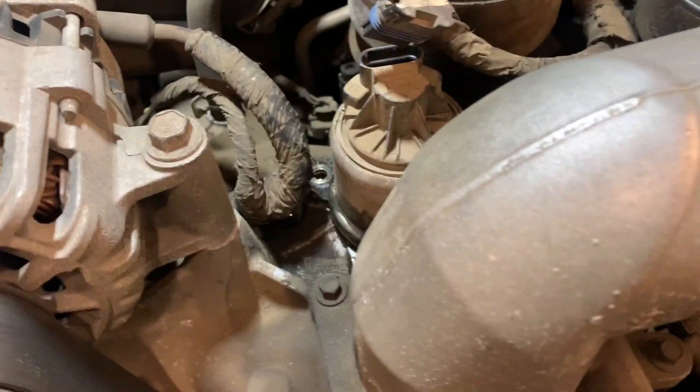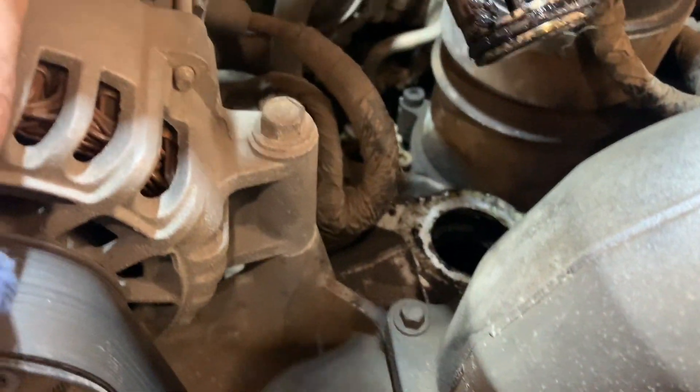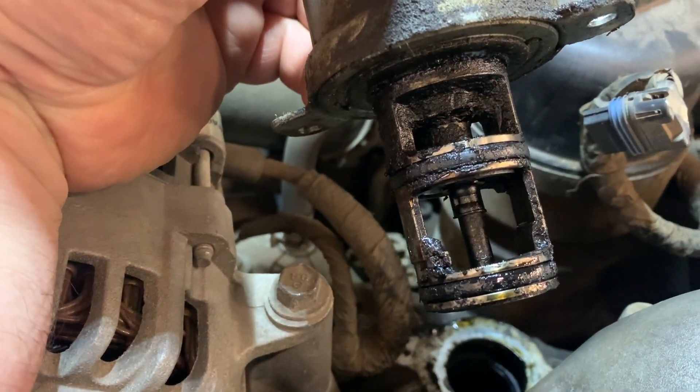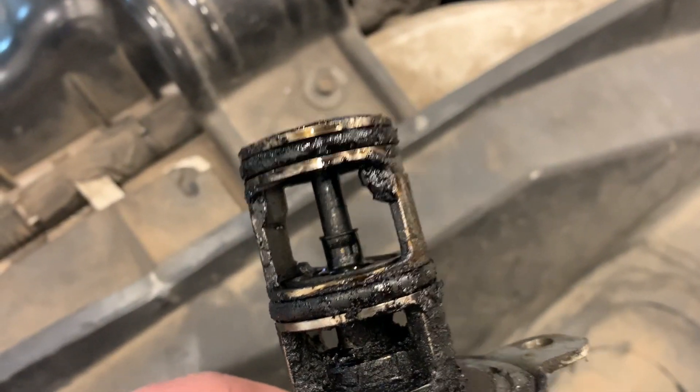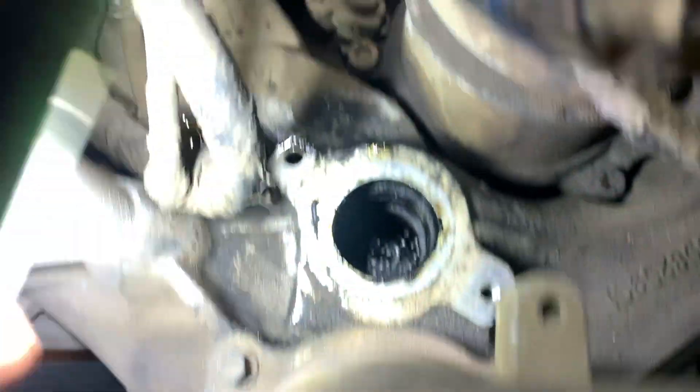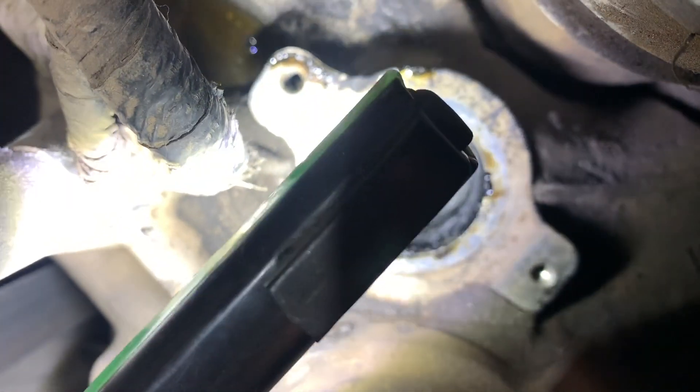I found this little heel bar was just perfect to get in there and pry it up. Now this is the sign: if your EGR valve is wet, got moisture on it, or you shine your light in the hole and there's moisture or coolant in there, that's a pretty good sign that your EGR cooler has failed or is in the process of failing, depending on what condition it's in before she blows up.